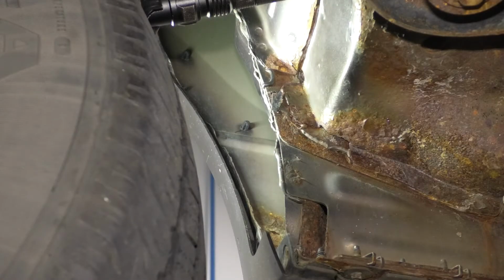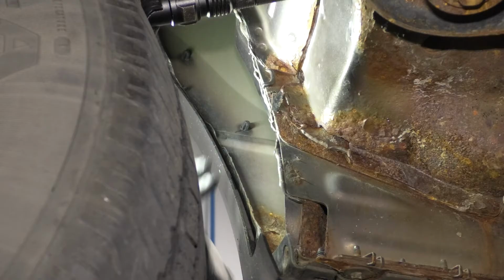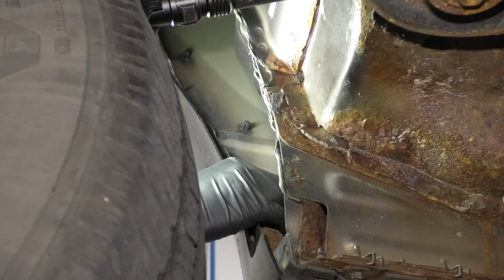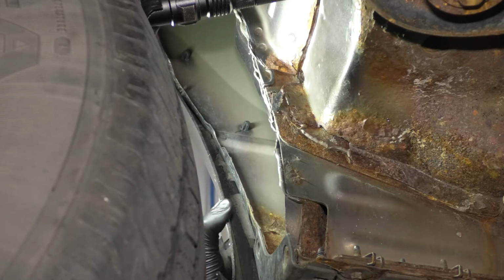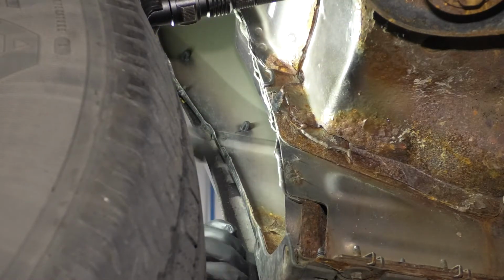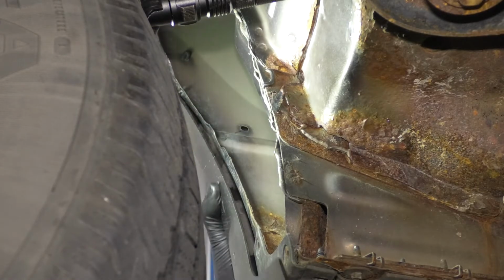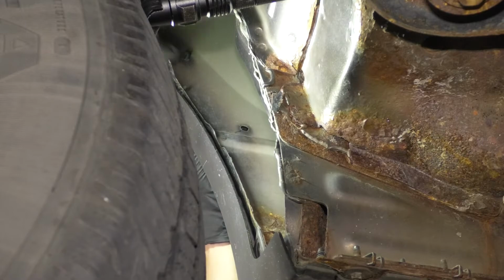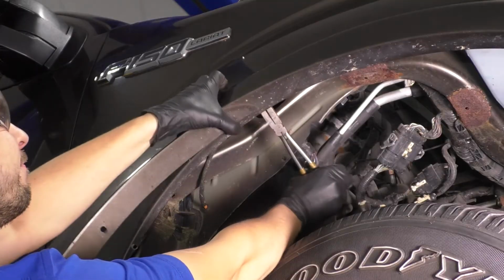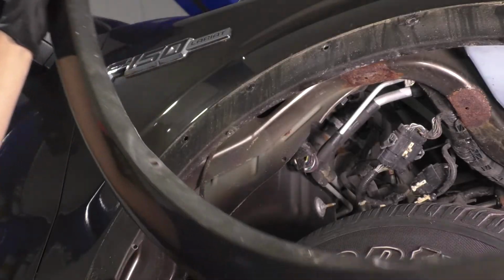That's all right. Looking from the back side, right behind the fender liner, this is towards where the door is, you'll see these clips that hold the fender flare on. We're gonna have to squeeze the two tabs on these so you can actually pull this away without damaging anything. I like to do this with needle nose pliers. Just clamp it and pull it away. And just go around the whole thing and remove all of them. All right, take the fender flare off.